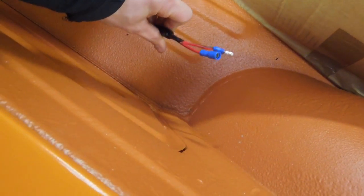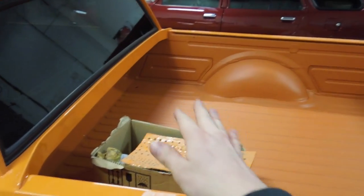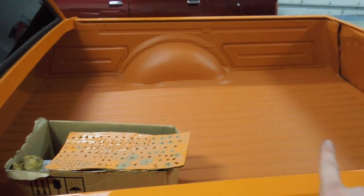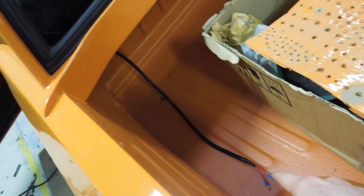There are some wires coming out the back which run through to the front — he wanted them wired up for earth and for a permanent power supply. What that goes to is a whole big assembly the customer has, which actually has sunken-in fridges, a big lift-up top with mirrors on it, LEDs under the fridges, and nice oak ply bar-leaner stuff that goes along here. So it's basically a great big bar, and those are the LED and power supply wires. I wired that up, tidied all the wiring, and redid the stereo installation because the wiring for that was pretty average.